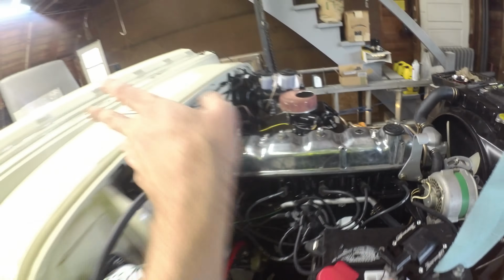So I don't have the original dash handy. I think it's tucked away in storage. I do have it though, of course. What's interesting is it had metal fingers that tucked under this lip here, basically, to hold this top down in place. This new dash, which is OEM Toyota, does not have them, but it seems like it's still got the steel stiffener. So basically it's got the same rib that runs down underneath. You can kind of see it there, that black metal. So it seems like they probably just stopped doing those clips, figuring that steel stiffener keeps it from warping.